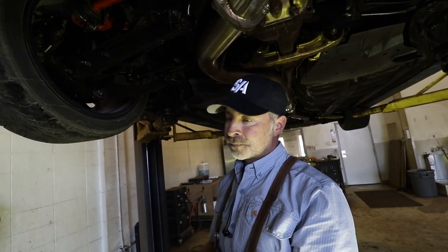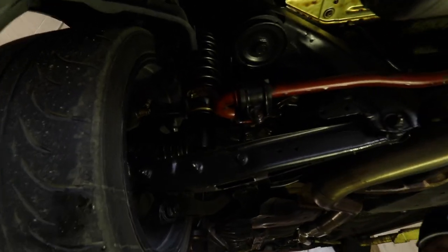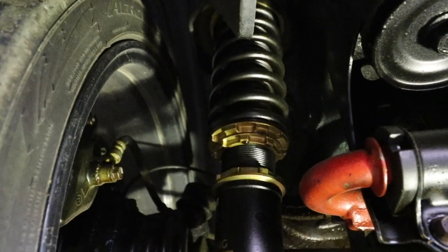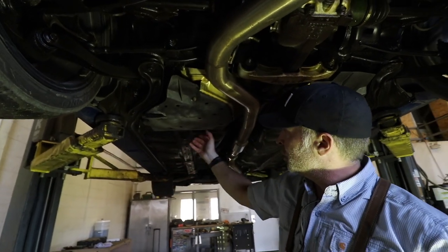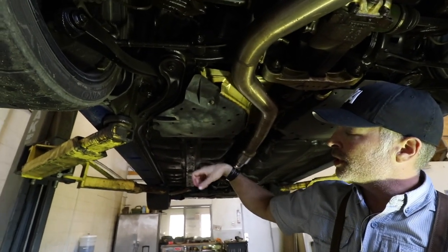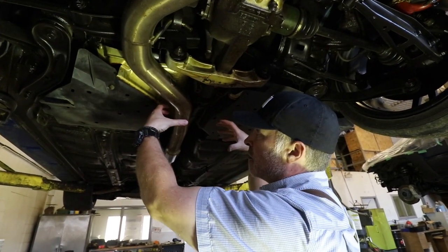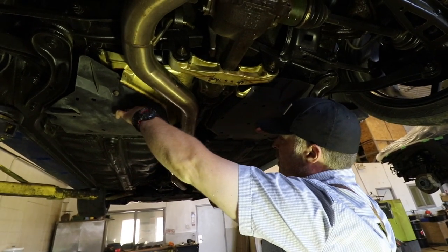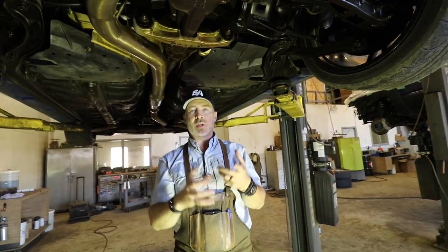That mentality is everything for a car guy handing their vehicle to a shop. The host says getting results like these is the best feeling. Ted points out the coilover collars — they look perfect with the wax on them. He explains they removed panels to access everything: for example, the fuel tank has plastic covers held up by steel straps, and the straps actually go up above the driveshaft and exhaust, so the fuel tank shields were removed to allow them to hit the steel behind them.